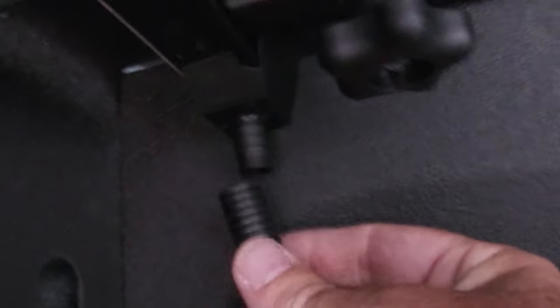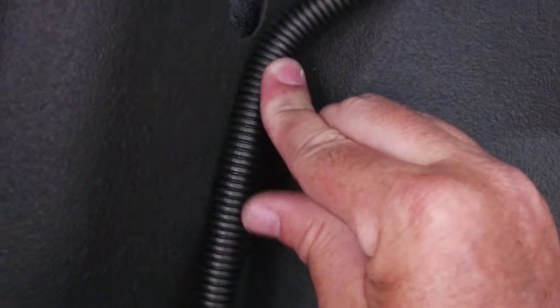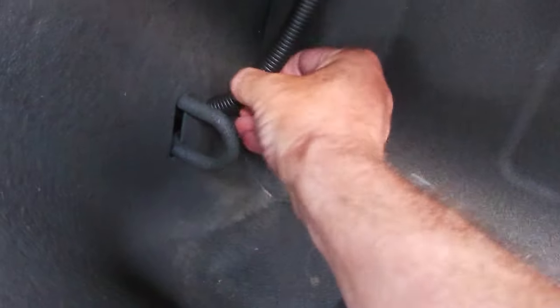Last step: drain tubes. Under here you'll see the barbs — just slide your drain tube up on there; twisting seems to help. Then you've got a couple of options. The default is to find the hole in the side of the truck bed and stick the end in there so it drains out. Your other option is to cut the hose shorter and tuck it into the top hole if you don't want it hanging down inside.